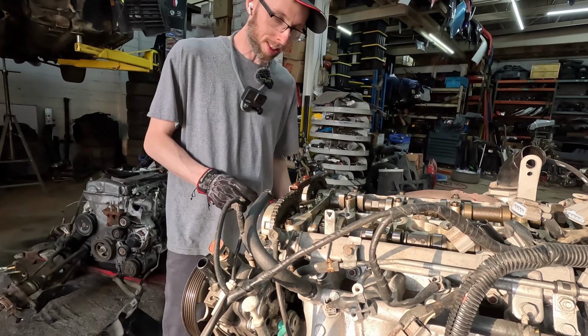So we took it apart to inspect it, but we didn't like how it looked. It looks like they used some sort of aftermarket chain, maybe. Marks there and there and up there and over there, but we don't see any copper marks. So maybe it's an older chain. Copper links. Yeah, copper links. So they marked these with like a paint marker. Either it's an aftermarket chain or it's like an OEM 08. So we're gonna update it. Cool. New.